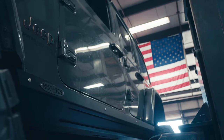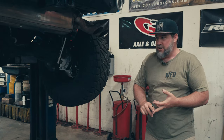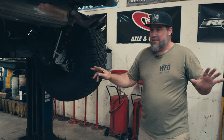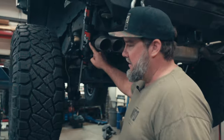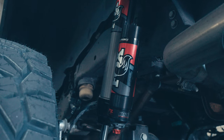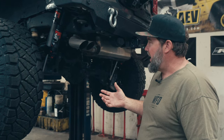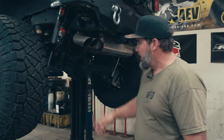In a sense you're getting 3.8 inches of lift and 4.56 gears installed with zero suspension or drivetrain bump stops or any of that. We left the links and the axles pretty much stock except for these Fox 2.5 smooth body shocks with the high-speed and low-speed compression adjusters. With the weight of the 392 and wheeling on 38s going a little faster, you still have a small amount of up travel, so big shocks, big fluid, and big valving definitely addresses that.